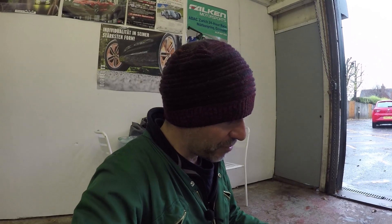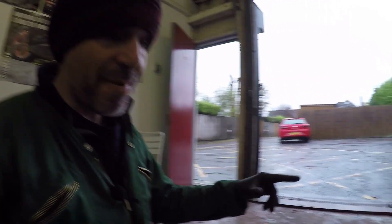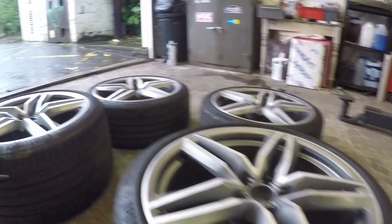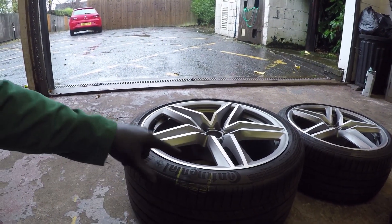There has been one major issue with the process. In the removal of the tyre, it's been damaged. Because these are low profile tyres the sidewalls were really stiff and take a lot of effort to pop off the wheel, and unfortunately this tyre is now scrap — which is a couple of hundred quid. There was a bit of adjustment in the price to allow for it, but it's got about 5.8 mm left on the tread. The problem is you've got to be very careful on four-wheel drive cars to run the same sort of tread depth on the axle, so I'm checking with Audi whether the remaining tyre at 5.8 mm will be okay paired with a new one at 8 mm.